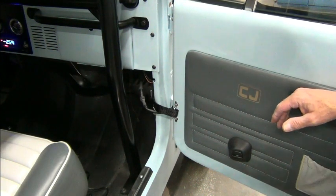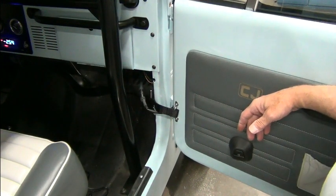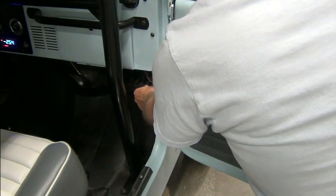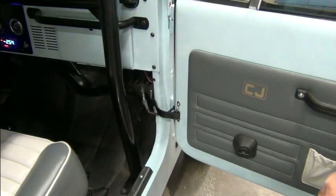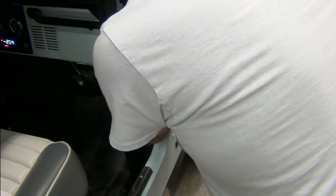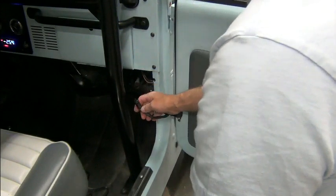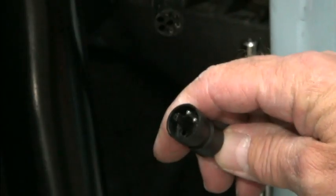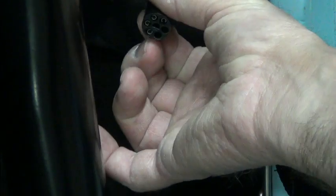First thing I did was look to see if the wires are connected to anything — they appear to be, but I didn't trace them all the way to their destinations. I noticed right off that this ground wire wasn't connected, and when I put it to ground I can hear a relay clicking over on the driver's side. But putting it to ground didn't change the scenario. I unplugged the connector right here and noticed there are four pins on one side of the wiring harness but only three pins on the other.